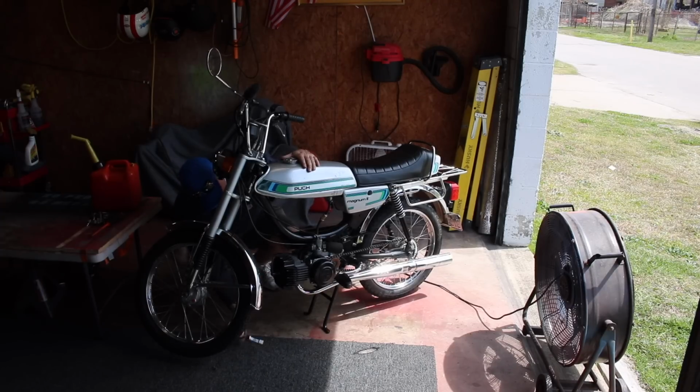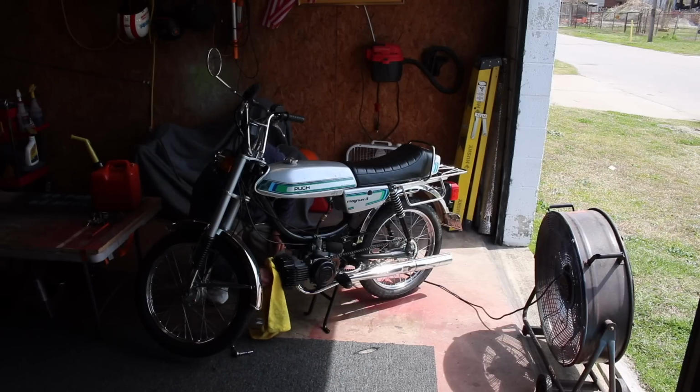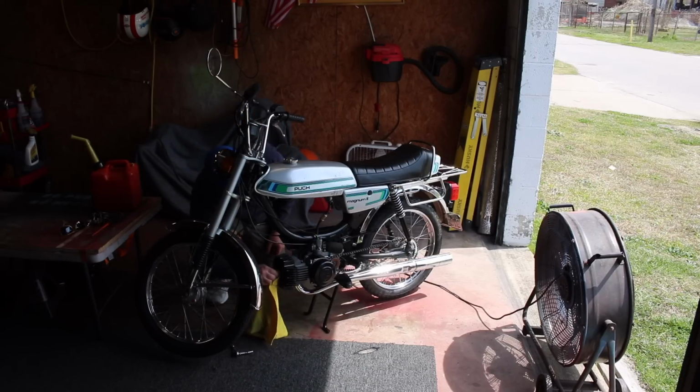Some dumbass didn't tighten the spark plug in. Super rich, but that's okay. We want to get some lube in there, so I'll let it run rich for this little trip I'm taking. Come back and I'll pull about 4 off of those jets. I'm at 76. I'll come back and do a 72, see what happens.